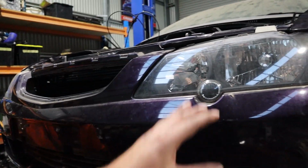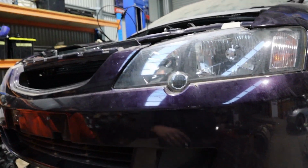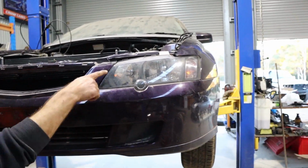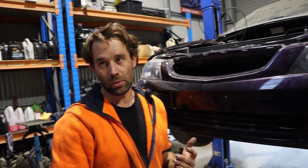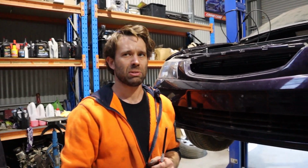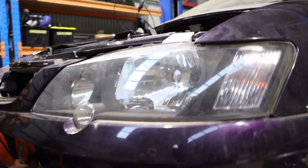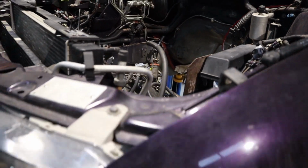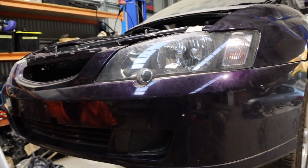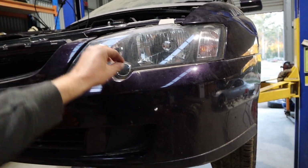The other thing we could look into is the headlights they use for turbo cars, where they remove one of the headlights and make it straight into the airbox that goes into the blower. For this thing, you could almost do that and the one in the bottom. Because as we saw from Darcy's Patrol, a 3-inch intake on something making power is not very much. That's what concerns me about this airbox idea. So we might end up looking into that, just making an intake there and one under the guard. I'm sure people make them. You see them on drag cars with turbos all the time. Like a half headlight.